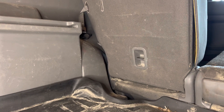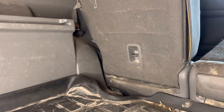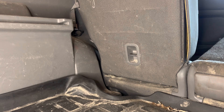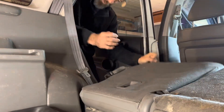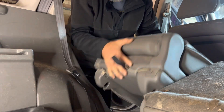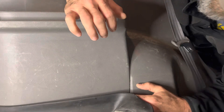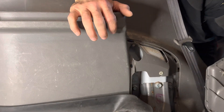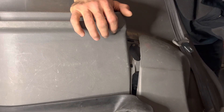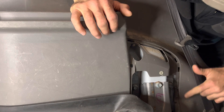While we still have weight on the wheel before we jack this thing up, we're gonna put down this back seat so that we can get to the top part of that back strut and undo the bolts. Lower the seat attachment here — you can pull on this little lever and that'll bring it up, giving us access to this port. We may be able to just pull that off without having to grab a tool. If it's too hard, you could take something plastic that's strong enough to wedge in there, but nothing metal because you don't want to bust that up.